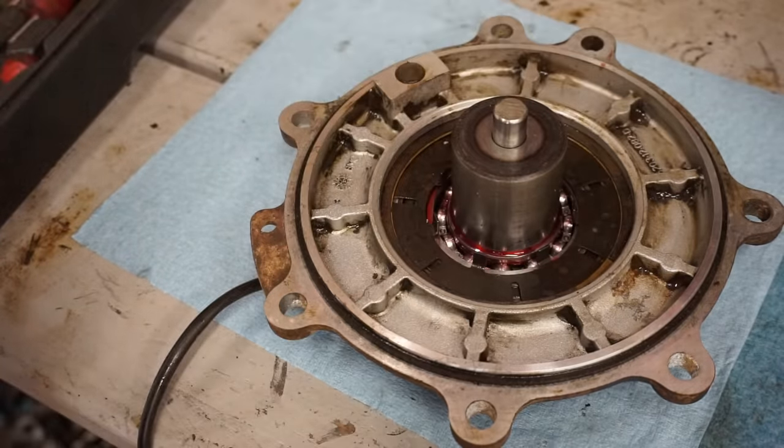That ring gap looks a lot better. A little bit bigger than 14. I'm guessing it's 17 thousandths. Yep, so we are at 18 thousandths for the ring gap. That is the second ring. Typically those are a little bit bigger than the first ring. Let's just see.